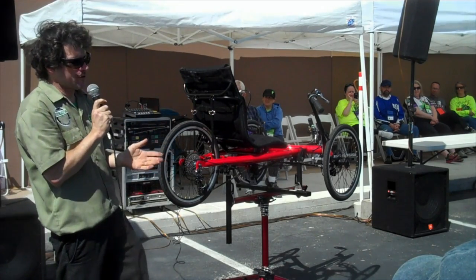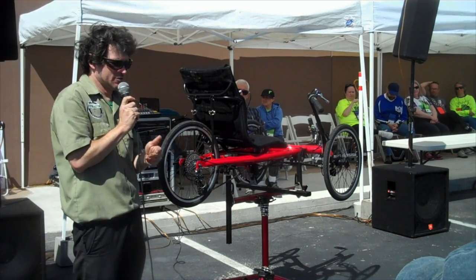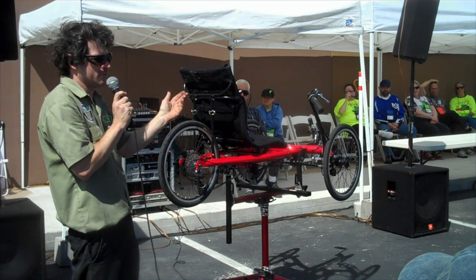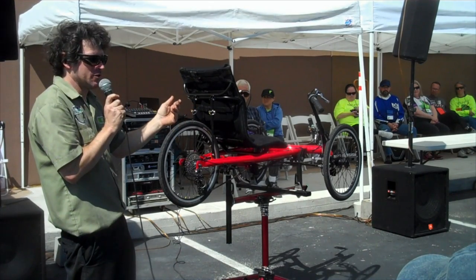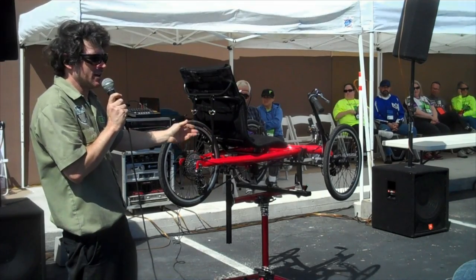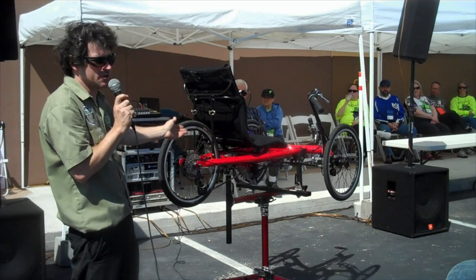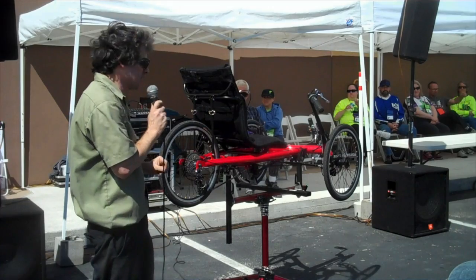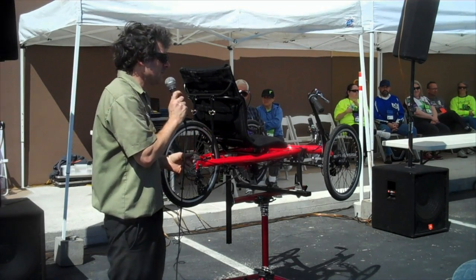Now, you have a problem with your derailleur alignment if it shifts fine at one end of the range, like in your high gears, but halfway through the range, something happens. You shift one gear and it goes two, or you shift one gear and it doesn't move at all. And then after that, it shifts fine the rest of the way, except you're one gear off from where you thought you were. The first thing you do is start playing with the cable tension, and all you do is move the problem around. Then you think that maybe there's more to it than just the cable tension.